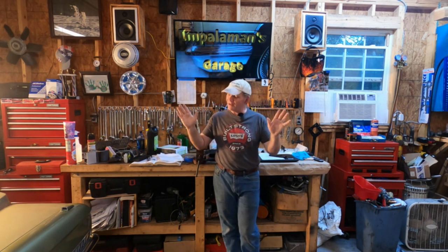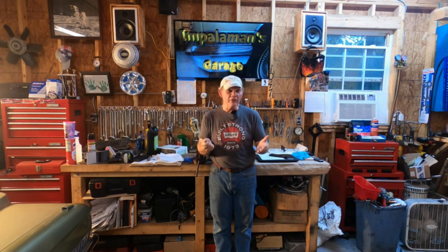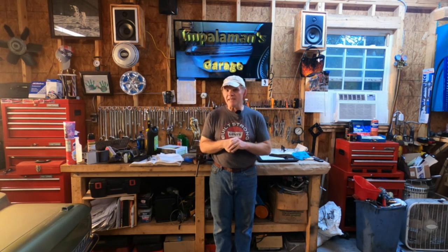Eventually, I decided to go with full manifold vacuum advance. And I'm going to have to admit, right here in front of everybody, that was a mistake. So I've been talking to some viewers in the comment section, and some guys on the Impalaman's Garage Facebook page. And their idea about the erratic idle, especially the behavior we've seen at the exhaust pipe, where you hold a piece of paper up there and it tries to suck the paper back up into the pipe. Typically, one would associate that with a sticky exhaust valve or distributor rotor phasing.